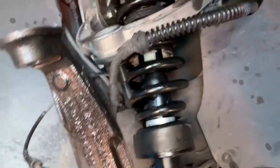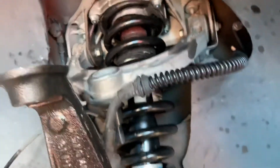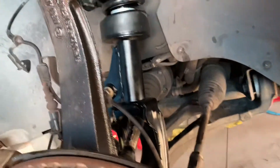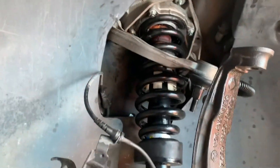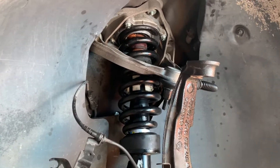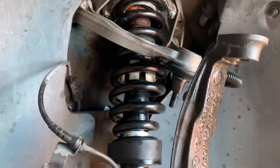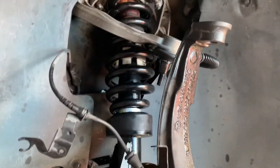The lower and upper rubbers were actually still in really good shape, but a couple of the parts inside definitely could have used another $250 in sundry parts. Not having the bellows might make the shock wear out faster, but if we get half the mileage we got out of the last ones, I'll be very happy. This is a 2004, so Gen 1, good up to 2006, steel spring Cayenne S. Changing the front shocks is not the hardest thing in the world, but these are heavy-duty springs — make sure you use multiple spring compressors. That is a lot of pent-up energy.